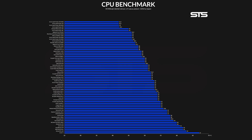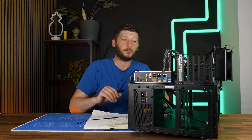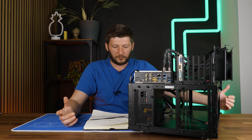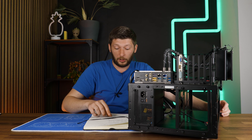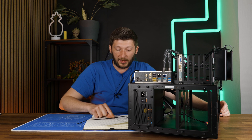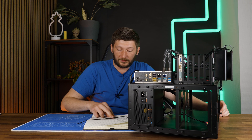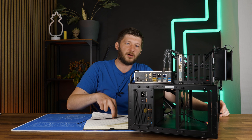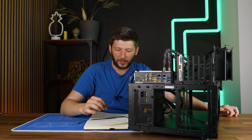Take as a comparison our previous benchmark machine, which was also 135 watts — and there, everything above a Noctua NH-D15 became so squished because there was just not enough heat to make a difference between a good cooler and a bit better cooler. So I accepted that. For the mid-tier 225W workloads it made a lot of sense. The 360 had 63.8°C above ambient, and the 420 had 60.5°C — so 3.3°C less going from 360 to 420 — which made a lot of sense.